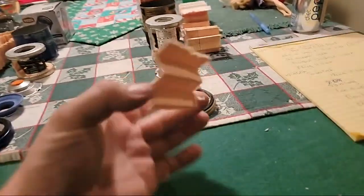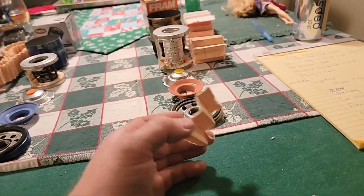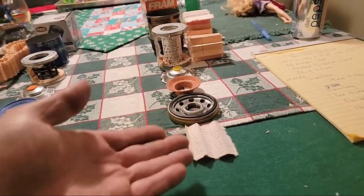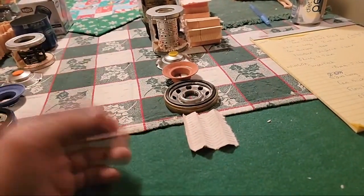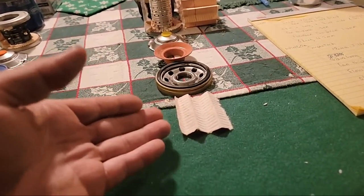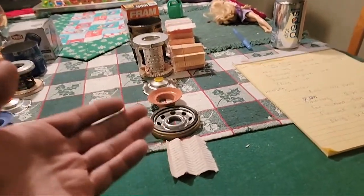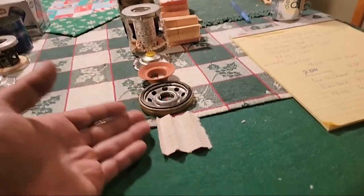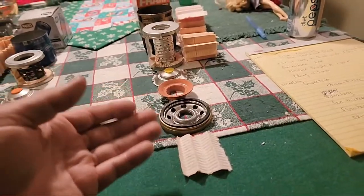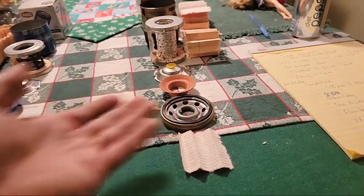They went to this type of material so they could actually take the metal out of it and add more filtering capability and increase that filtering efficiency at the lower micron level. So at 15 microns, it now filters at like 93% efficient. And then at 10 microns, it filters at 74% efficient. So they've really upgraded this, and a lot of people don't understand what they did with this filter. Ballpark, they've added about 12 to 16 more pleats inside the filter itself to make it a more efficient, better filtering filter, and actually pulled the numbers up at lower micron.